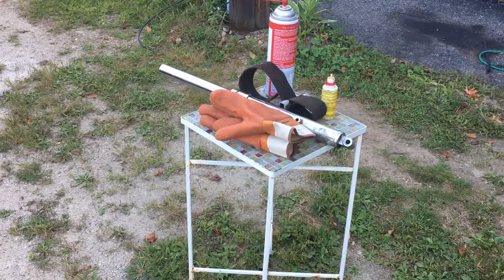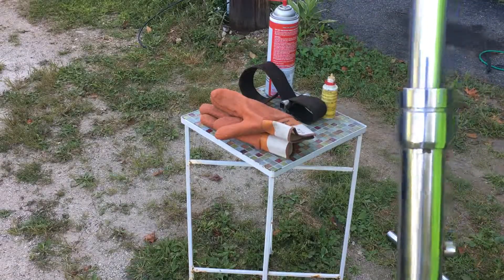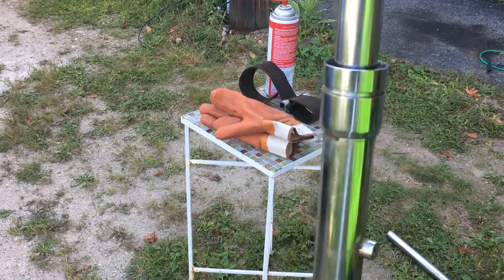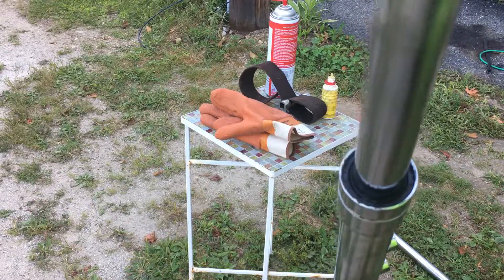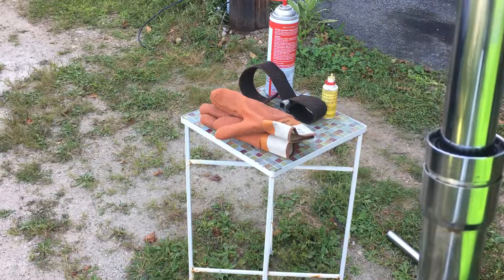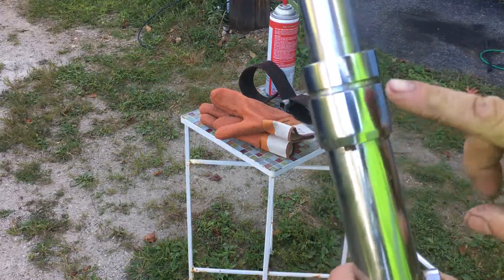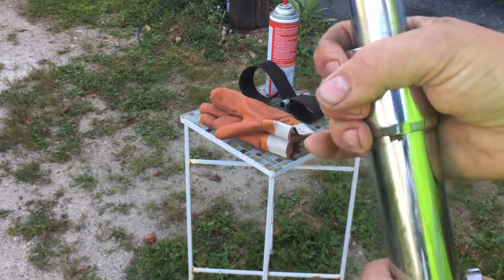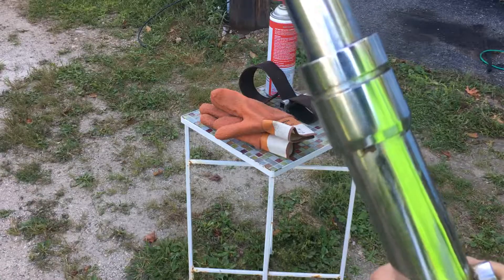I have a lot of people who have the 70s ones as well, so I'm going to show you guys — it's a little different. You can see the seal, but there's no retainer clip. The shock looks like this — a different style. You can see the seal right in there and you might think, 'oh, that's easy to get out' — and it's really not. This collar right here unscrews, but it's very hard to unscrew.